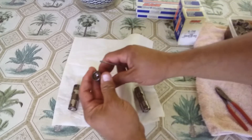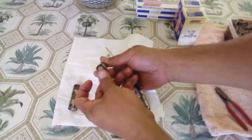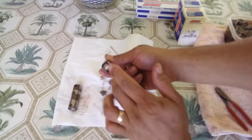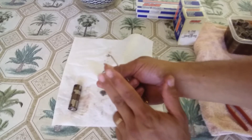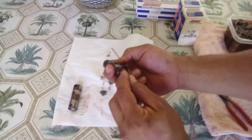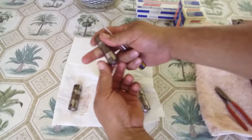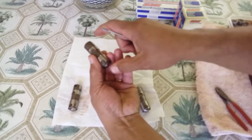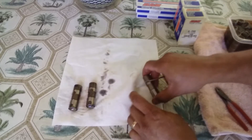You too can rebuild the lifters. If there's nothing wrong with them — you don't see any chunks missing — but if they don't spin freely, like this one wasn't quite spinning freely, there's a little resistance, you can tell it's grimy in there. There are needle bearings inside that you can't quite see, but they're in there. That's how you take them apart and put them together.